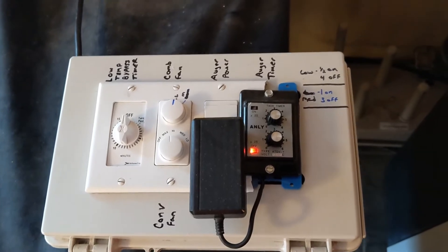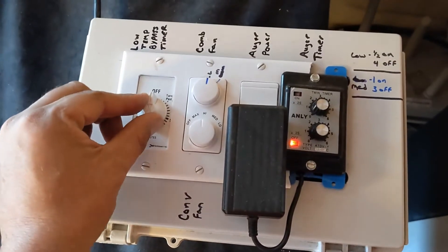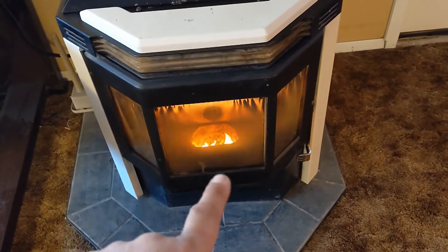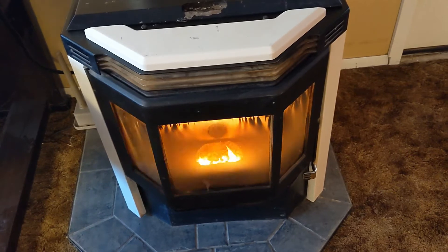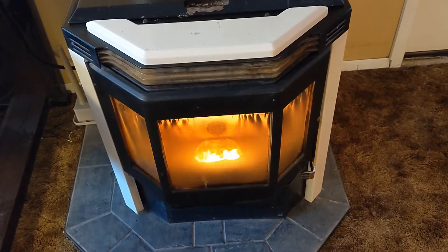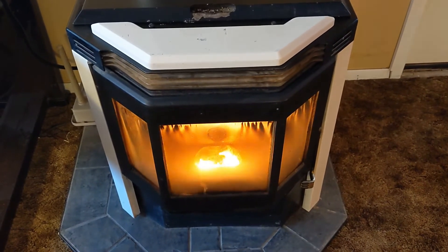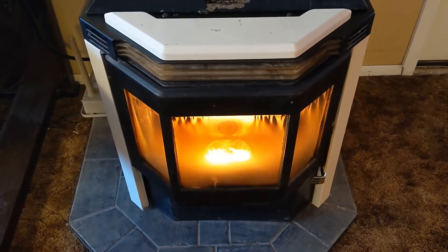It's been running off of this box for almost a week. I was able to order parts for it, but I thought I'd show everybody what I got set up here. This is my low temp bypass — I have my safeties hooked up. I have both the low temp, so if the fire dies and it's not going to have a fire in the fire pot, it won't just sit and fill the auger with pellets. You also have a high temp so if the fire is too big it'll shut the auger motor off.